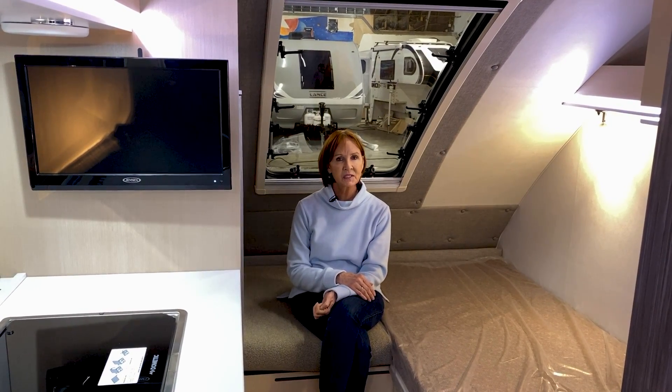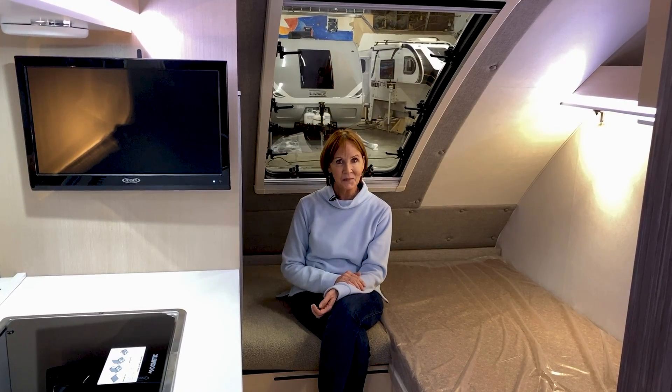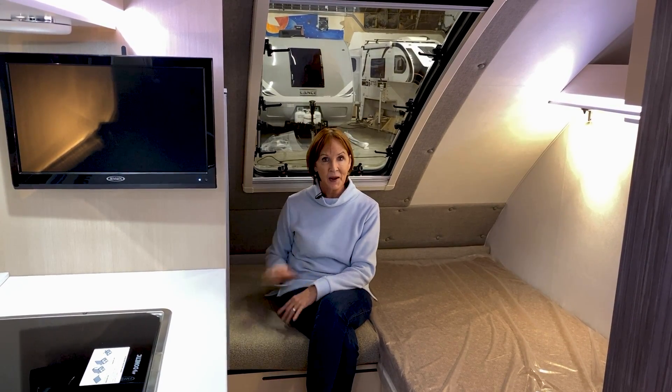There is no storage underneath the seating or underneath the bed here. Under the bed you're going to have two six-volt AGM batteries — no maintenance needed, no water to add, with a good long life. Next to that is a 1,200-watt inverter. That inverter takes battery power when you're boondocking and converts it to 110 power — push the button in that cubby and the 110 plug works. Because this is the Boondock package, it also includes a 150-watt solar panel. The solar charges the AGM batteries, and the 1,200-watt inverter gives you the 110 power you need.